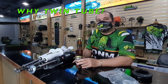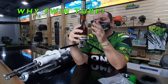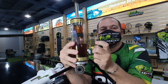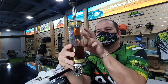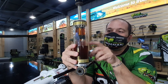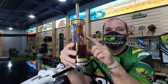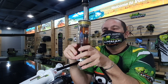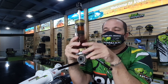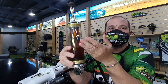Advantage and disadvantage of twin tube and mono tube: if I hit the outer tube and bend it, the shock does not really care — the outer tube is just a reservoir. What's important is the inner bore. In a mono tube, you don't have an outer bore. Anytime you kink the shock body on a mono tube, the piston won't fit the body and the whole thing just stops working.